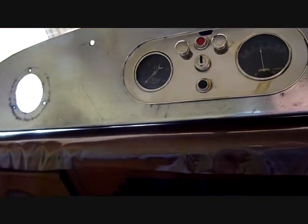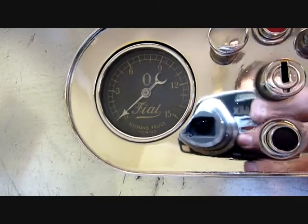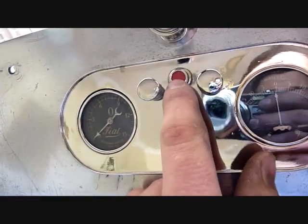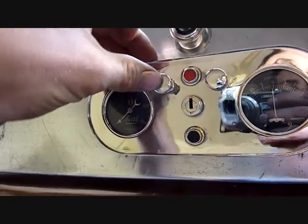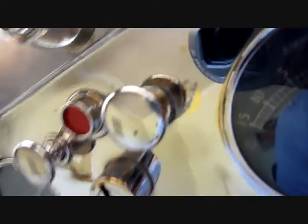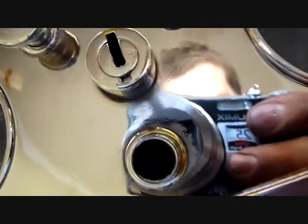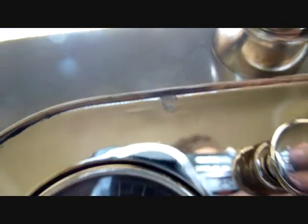Meanwhile, I've been mucking around on the gauges and the dash. This is the original dash from the car — you can see it's got all kinds of scratches and marks. I've polished it up a fair bit, hoping I could reuse it, but I don't think I will — I'll have to get a new one made. This is the dash cluster. The gauge faces are original and so is the glass. I'd get the rims re-nickeled and the front face re-nickeled, with your starter button here and your interruptor button — which is your stop button. These knobs here operate your lights: one for your headlights and one for your side lights. The only thing is the guy that nickeled it didn't do a very good job — you can see there's a chunk of nickel right there, and a shadow effect on the rims. Up here, that was a little repair done with solder, and nickel didn't cover it at all, which makes me wonder — I wish we knew nickel doesn't stick to solder before.